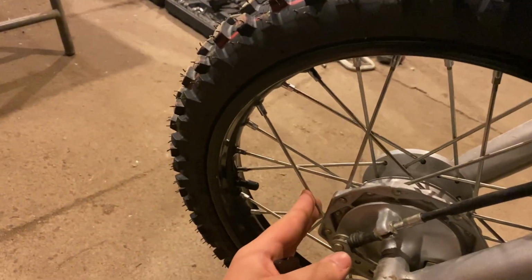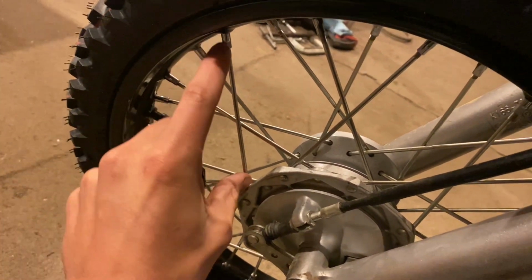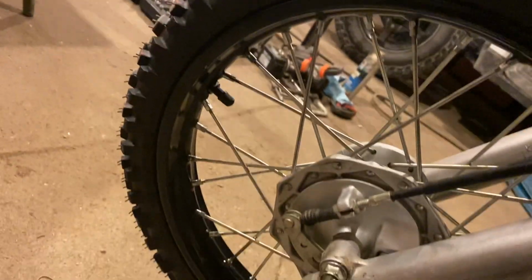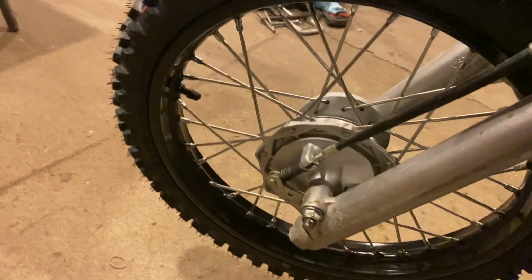And for taping off the rims, all I did was cut up plastic straws to length, slit them open, and put them over there. And that worked out really well. Really no overspray on any of them. A little bit where the slit was, but that's way easier than taping off each individual spoke. And I just threw a rag over the center hubcap so I didn't spray it as I was spraying each side.